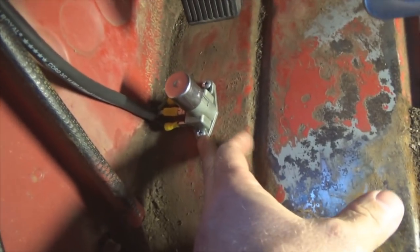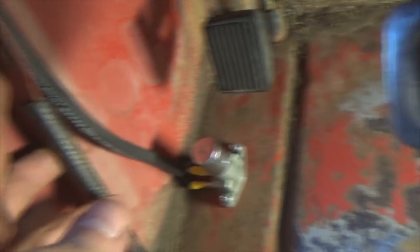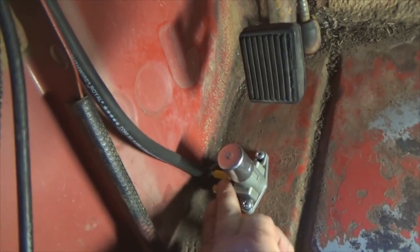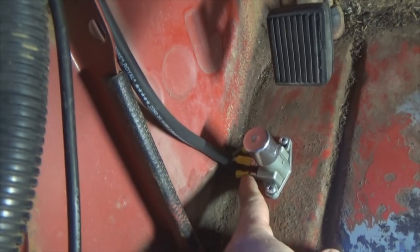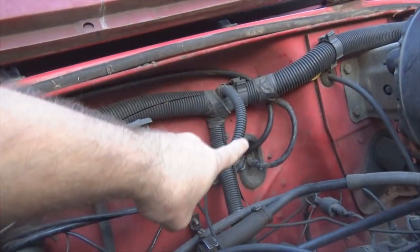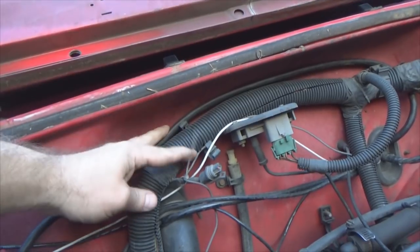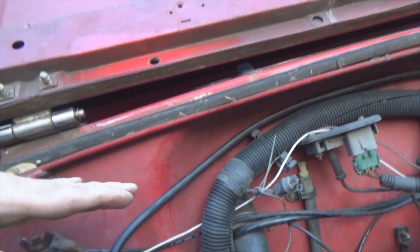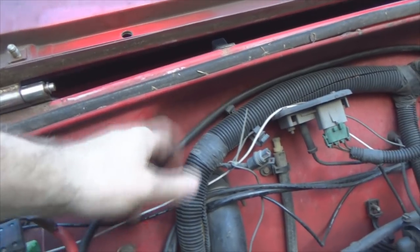I've got the switch mounted with screws and the wires tucked to the inside toward the side panel. In a moment I'll use wire ties to secure it to the pinch weld seam so it stays out of the way. The center of the switch is white going to battery, green on one side for the super bright light, black on the other for the daytime running light. Coming out of the firewall, I'm taking it above the loom and around this way, then zip-tying it right to the wire loom. The service cord jacket blends right in — super rugged, good thick wire, carries plenty of amperage.